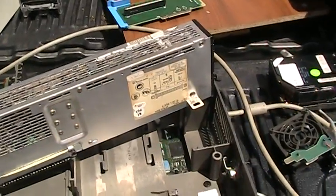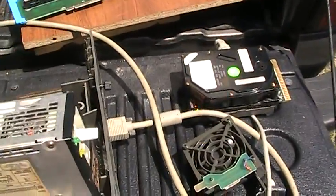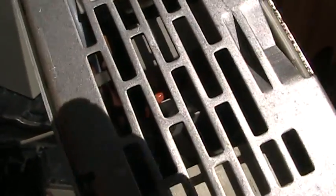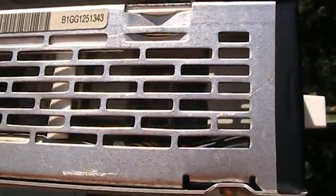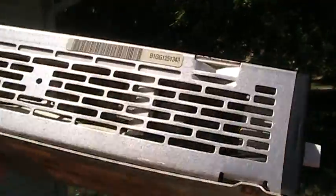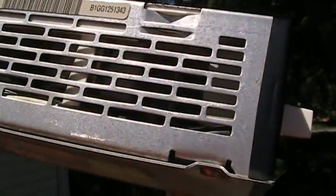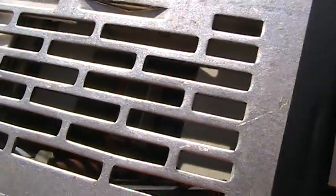Now that the dust and the smoke have settled, I don't think it was the hard drive that smoked. The hard drive is no good — it throws a 10483 error code, which is definitely some sort of a mechanical problem. The source of the smoke seems to have been the power supply itself. If you look very carefully through that grill, you might be able to see there's a white plastic-bodied capacitor that looks to be sitting right across the power switch, maybe some sort of a suppression capacitor. You can definitely tell that the casing is cracked in two. The casing is cracked in two, and the smoke smell is the strongest around there. That capacitor probably isn't strictly necessary for this power supply to operate correctly, so as soon as I can find my security screwdriver bits, I might just go ahead and pop it out of there, or maybe see if I can harvest a suitable replacement out of something else.